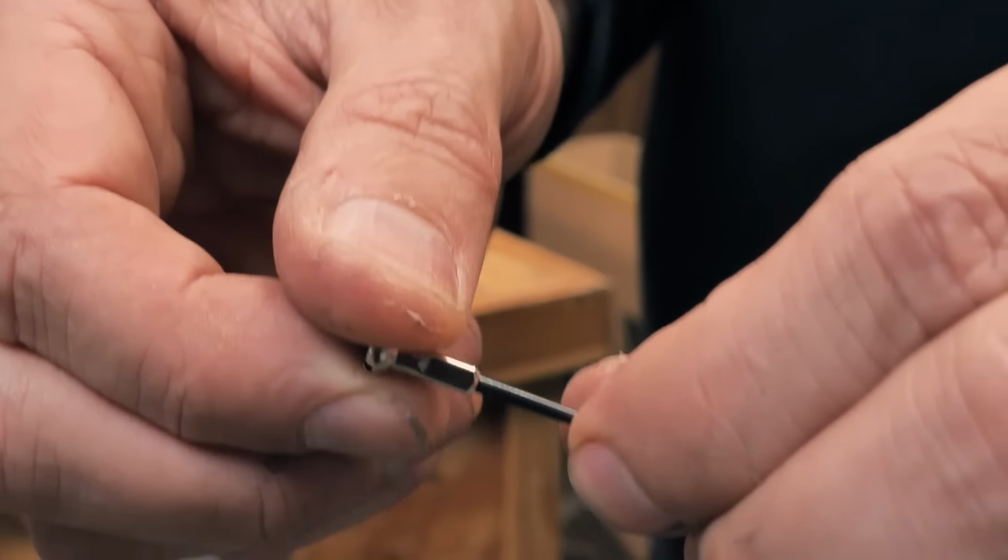I think that's a fairly good base, so long as you've got the tools and the good quality materials that are going to help you achieve that. Sometimes the quality of the materials just doesn't help you at all. In this case, we're about 0.5 of a millimeter left and right, which is okay for a cheap budget wheel. And I think if I spent another 20 minutes or so with this, we'd easily get it down to that 0.2. And the final dimension to this is tension.